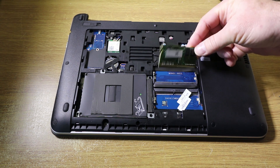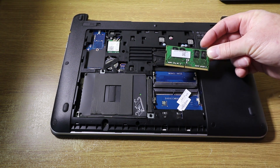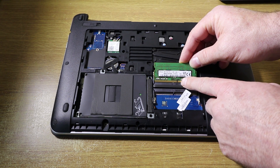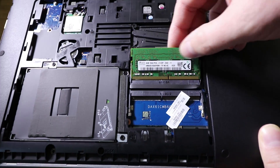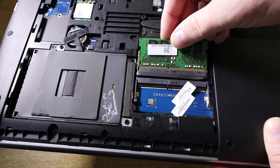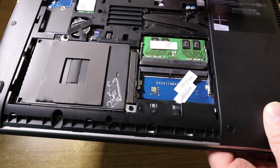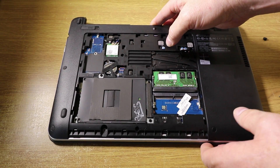To increase or add extra memory or swap this memory, there's a notch there that's slightly off centre — there's only one way it will fit in. So if you try to fit it in the wrong way it's not going to fit. That notch will line up the right way and then it just slides in and pushes down. And that's what you need to do if you want to swap or increase the memory in the laptop.